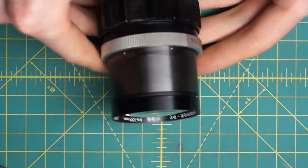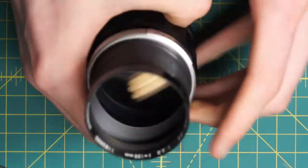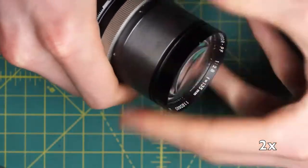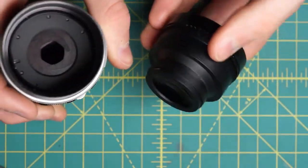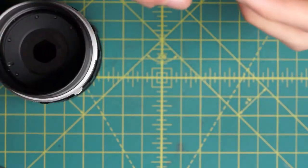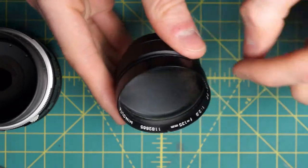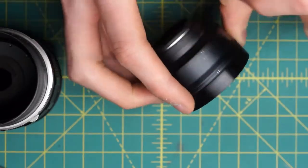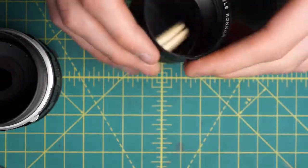Now we have access — you can see the front optic here and then the main lens barrel. Just grab the front optic black section and unscrew that. You can remove the entire rather large front optic piece. I believe you can further disassemble it — there are little divots on it for a spanning wrench where you can remove the individual elements if there's fungus inside. This also allows you to clean the back and front surfaces and remove any dust.